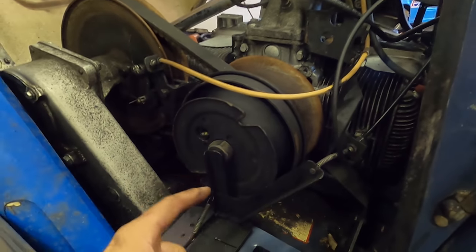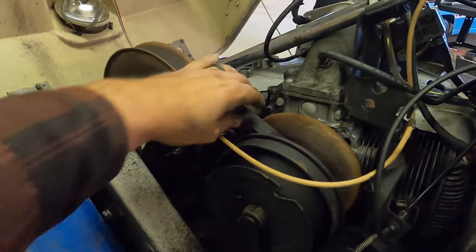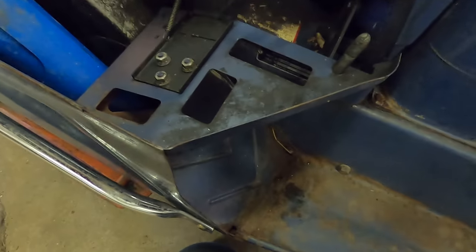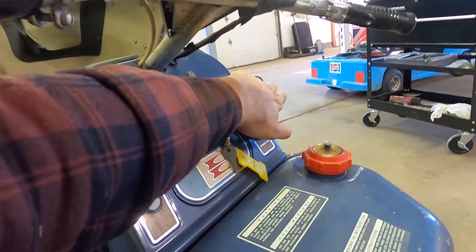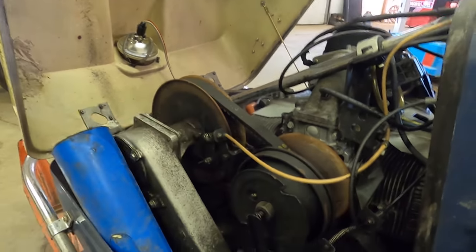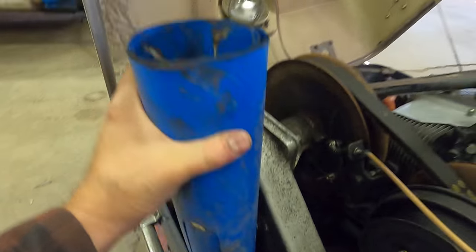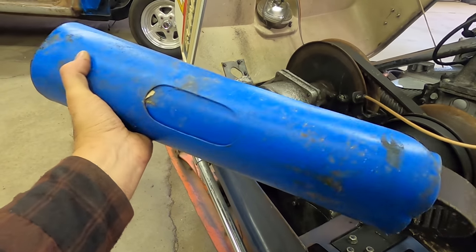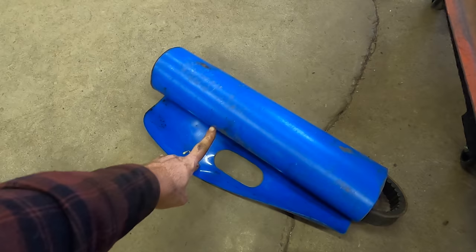This cable is a neutral lockout. If I depress this pin, you can idle it and free rev it and it's not going to engage the belt. This is hooked directly to the sled, so if I roll this the sled will actually move. You can warm it up this way, then pop it out of neutral lock and this clutch will move, the belt will walk up, and you can actually move the sled. This belt, based on the owner's manual, I know is from 1991.